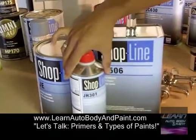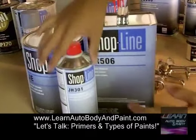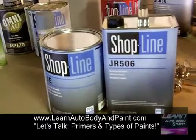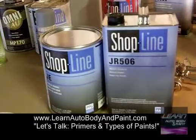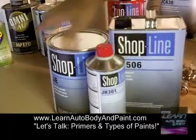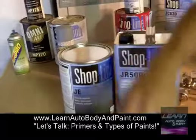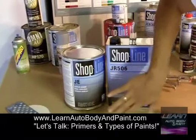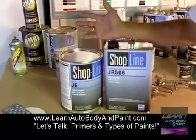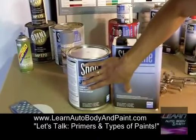To turn synthetic enamel into an acrylic enamel for a stronger, more durable paint, they sell you a hardener to mix with it. Once you mix the hardener with this system, it turns it into acrylic enamel — the stronger type of paint. It's only about $30 to $40 more for the hardener. Without it, it's a synthetic enamel and it dries perfectly within two hours. You're not going to have a drying problem either way.